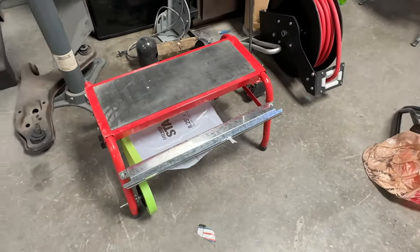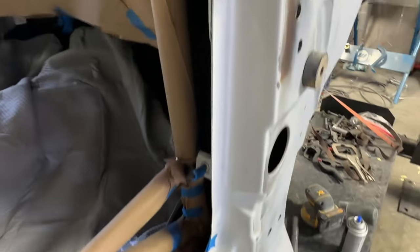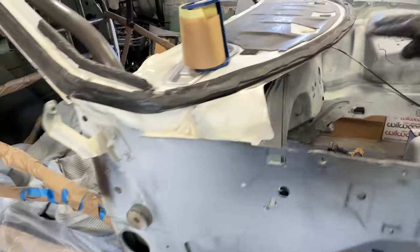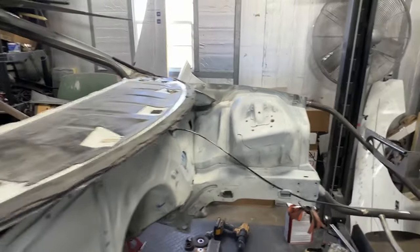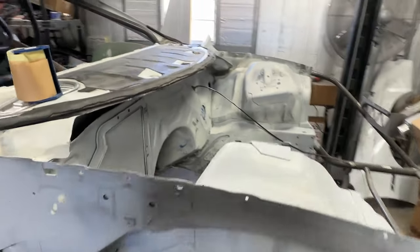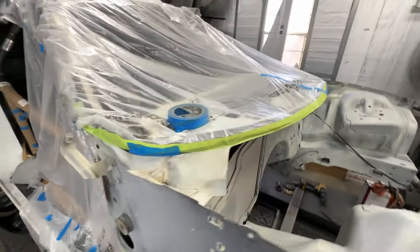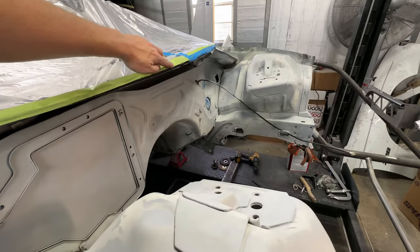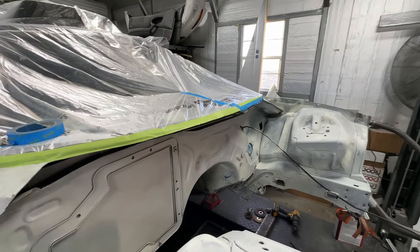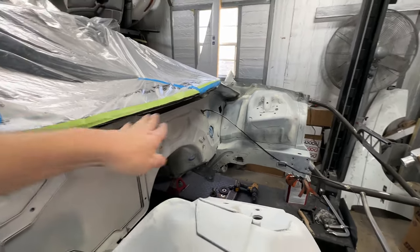I went ahead and picked up one of these cheap little Amazon dispenser deals. Did a little test spot right here but I'm going to tape up along the body right here where it's glossy. I'm going to tape the edge up along the window - that'll be nice and easy, same on that side - so then the whole front end is nice and white. Most of this you won't see because it'll be under the fender, but at least it all matches and is sealed. It does not stick very well to the rubber that was there from the factory window seal, so I taped it around in the center, which would leave a little spot unpainted but it's up under the cowl - not a big deal, but it helps from wanting to float up and spray back in there.